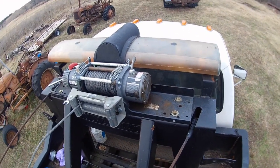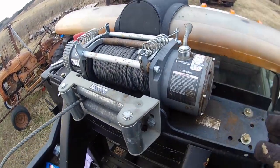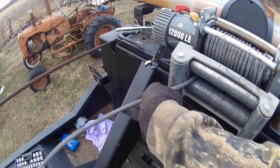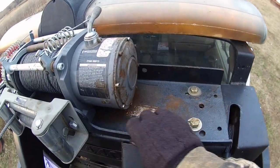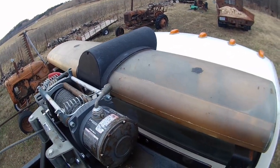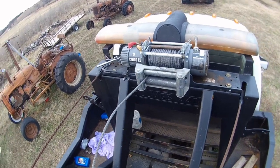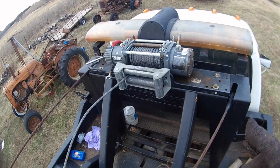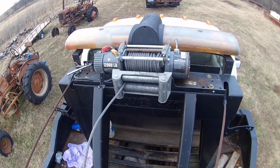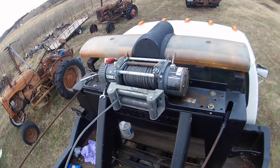So we're going to put a new winch on it. In case anybody's wondering, the way I did this: I mounted this 12,000-pound Harbor Freight winch to their universal mounting plate right here. It works real good because you've got your rollers — when you do heavy loads, you can pull it straight or sideways and it's still got something to roll on. We bolted it down to the top of this 440 wrecker bed. And with the tow light and wrecker light on it, it hides it. You can't see it hardly unless you really get up here and look. Going down the road, people just think it's a regular wrecker. You've got the wireless remote and everything. One thing I really like about the electric winches: no hydraulics. You don't have to deal with PTOs, no pumps, no leaky seals, no hydraulic cylinders going out, no busted hoses. Very cheap maintenance. Five years, one winch, 300 bucks. You can't beat that.